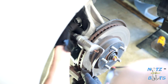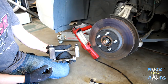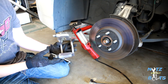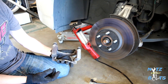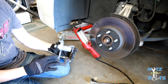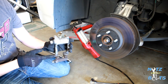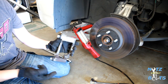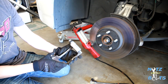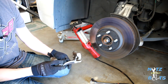When you pull out the second bolt, hold on to your bracket. Here is the caliper mounting bracket — it is marked with an L for left. Make sure all your fit kit pieces are in place and not damaged. There are spring-loaded tabs that hold the brake pads firmly in place, and your pins should be sliding freely with the boots not damaged. Everything looks good to go.